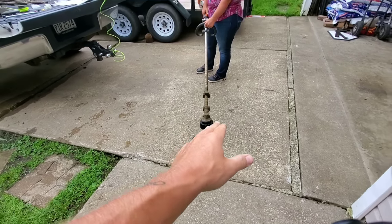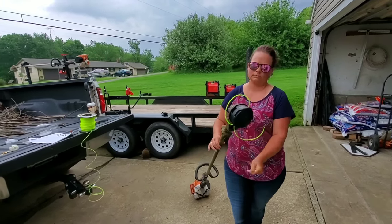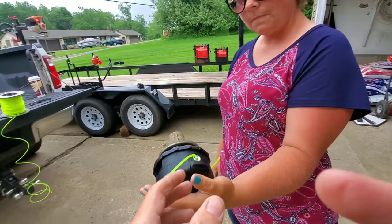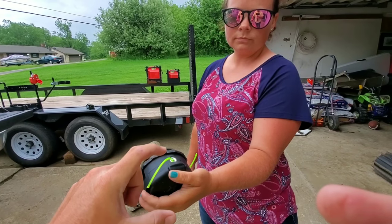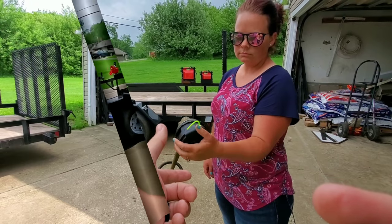Now, you have to remember, there is a curved shaft and a straight shaft version to the internal parts of this here. Got it there, TQ? Yep. Basically, guys, if you bump it and it pulls your string in instead of coming out, that plastic internal piece there that we put the nut in, you have to flip that over because that's for the curve shaft, okay?